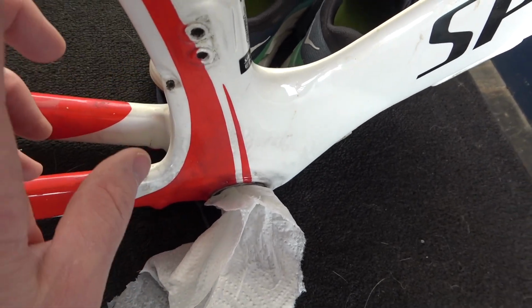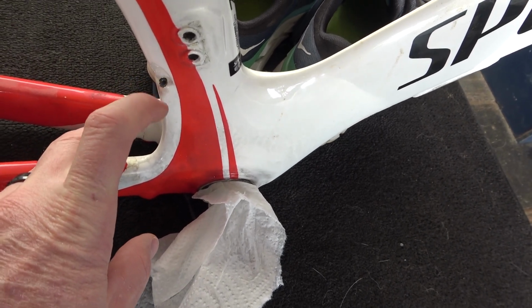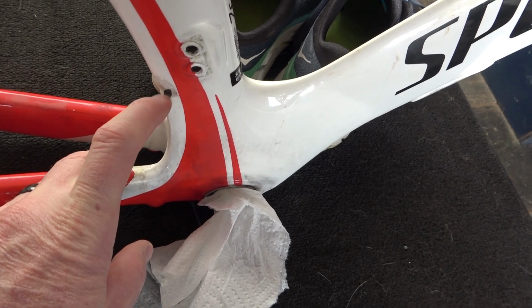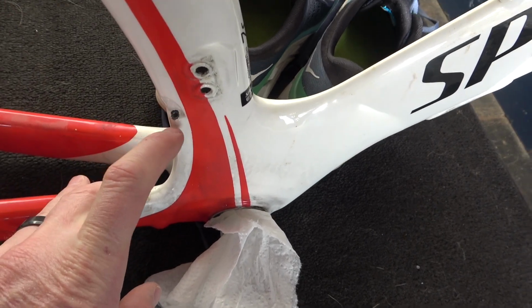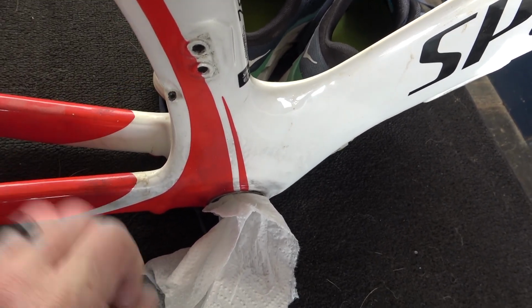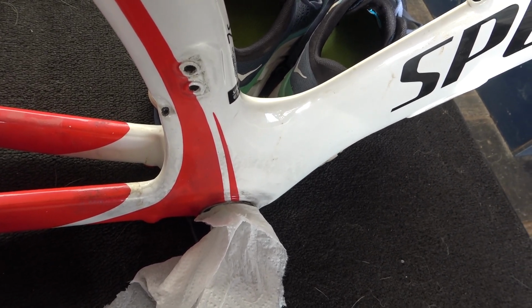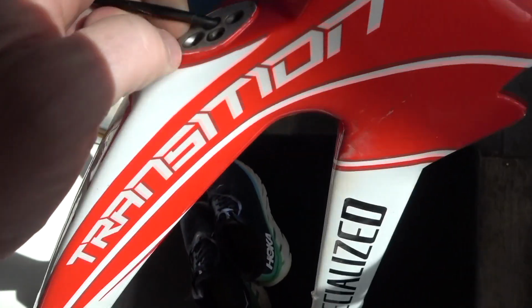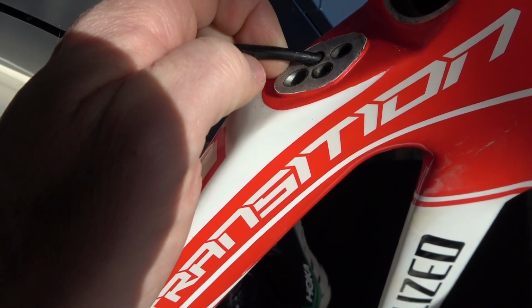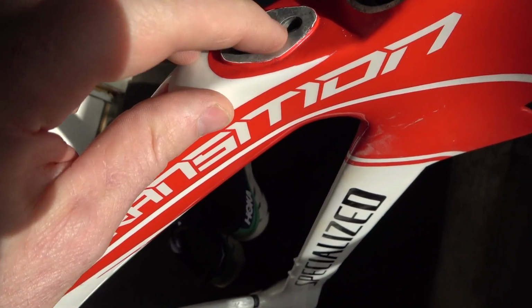And so you can dribble these sugary drinks down there, and there could be some regular corrosion in there as well. It's old housing, but that stuff crystallizes in there. At least that's my opinion. Crystallizes in there, and then you never get it out. It dries to like a glue, so it's probably that, or just the cable housing itself has degraded so much. The inner cable wrap is rusted and interacted with the tubing that they put in there.